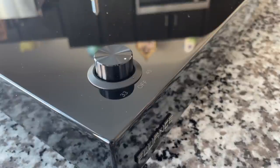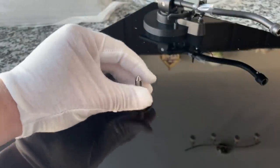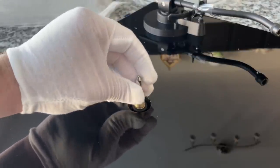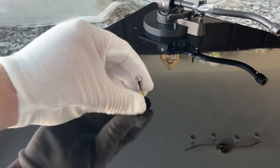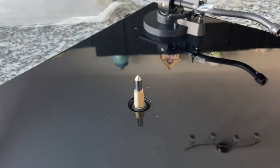Let's look at the main bearing. The main bearing has some drag on it, and I believe that's because the mass of the acrylic platter is fairly heavy — this needs to match that so the turntable maintains the proper inertia and momentum. If this were too loose it may have a hard time fighting against the variables of the motor itself. The reason you want a heavy platter is so you have mass inertia to overcome speed fluctuations.